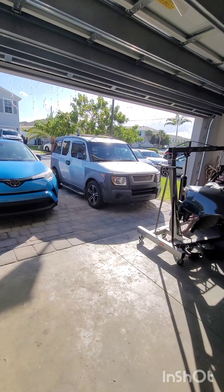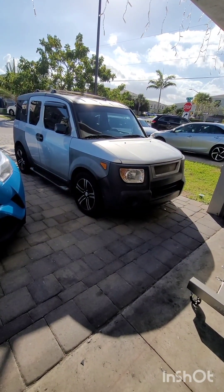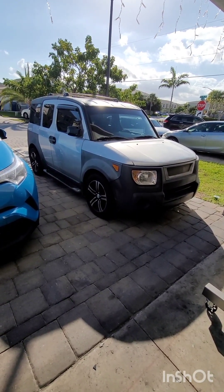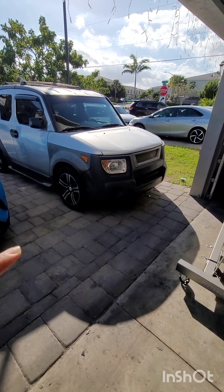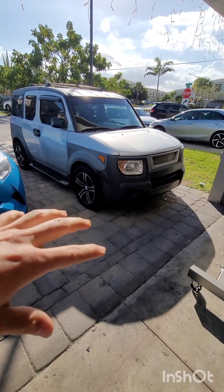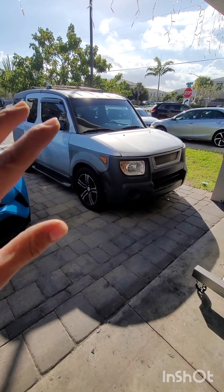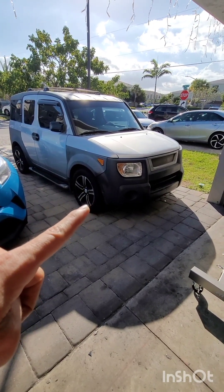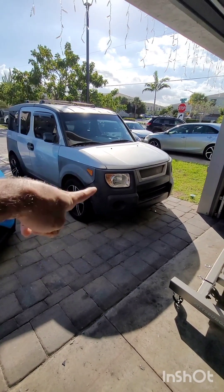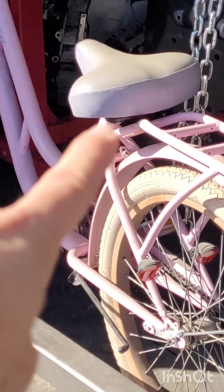This thing right here is a piece of crap. Right after I came back from Tampa it started acting up on me. The car runs and I can put it into reverse and drive and go through all the gear settings, but it doesn't go past first gear. All the services are up to date — transmission fluid, filter is new, everything. Either the TCM went out and it can't determine when to shift from first to second, or the transmission is screwed. So screw this car — I'm gonna find another daily.